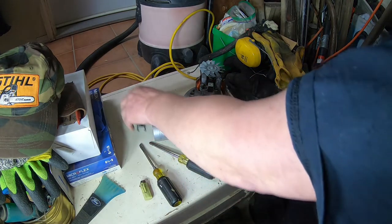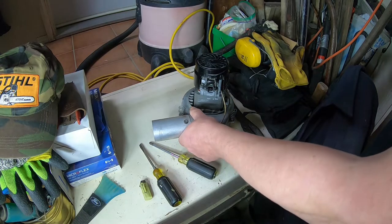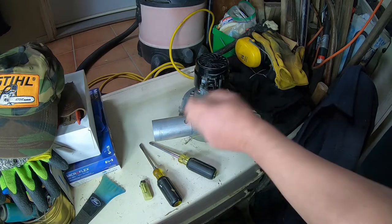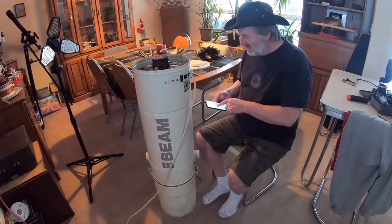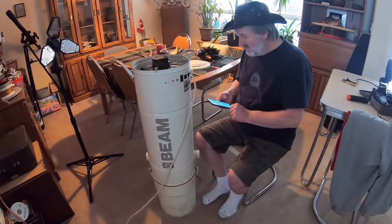I'll make sure I have them in front of me - I'd rather be looking at them than for them. This video is gonna get a bit long, so I'll probably have to make a different video of replacing the brushes. This little thing here, you just pry it out with a screwdriver - you can see it goes right in there and just slides in. As far as the brushes go, yeah, I think they're kind of done. I'm gonna leave this one in until all the new ones arrive just so I have a reference. The bearing seems fine, it spins nicely with no resistance. So if I can find the right brushes, we'll change them and see if it works - it's probably twenty-five to thirty percent the cost of replacing the whole motor.